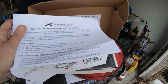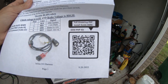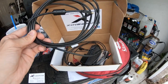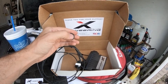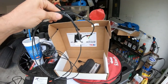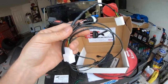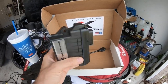Breaking down what comes with the kit: you get simple instructions, labels, the power and ground wires with wire colors indicating where they need to go, and a full install guide with a convenient QR code you can scan with your phone to get the full PDF install guide. You also get your OEM-specific harness. The interface you'll interact with as the operator has a manual on/off switch - if you don't want the auto rev matching, just flick the toggle switch to disable it. This is what wires into your clutch, brake, and throttle connectors, and everything is nicely labeled - clutch, brake - super convenient and well done.